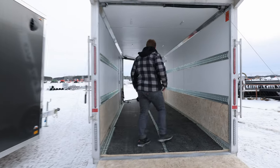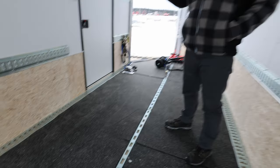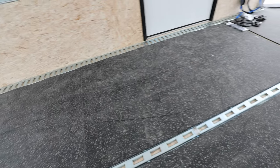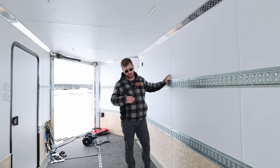Let's hop in. What I've done for my personal trailer — tying down tractors, snowmobiles, side-by-sides, four-wheelers, and of course moving — is called E-Track. Along the perimeter I've done the E-Track, and that's more for tying down tractors and side-by-sides because it's going to go into that two-by-four perimeter frame. Down the center I've done just a single strip, and that's just to cross-tie the sleds — not really tying down a tractor to it, but to cross-tie whenever I've got three sleds in here so they aren't shifting and rubbing and marking up paint.